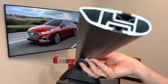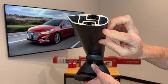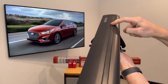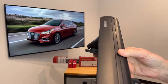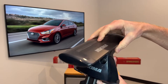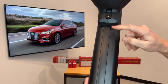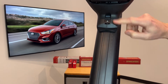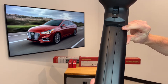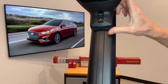This one we've cut down so you can see the extruded aluminum box beam construction. The overall shape is designed to minimize wind noise and wind drag. There is a track that runs along the top of the bar to accommodate certain accessories and carriers for a very clean integrated method of attachment. On the underside of the bar is another track in which the tower is attached. Alongside that track are measurement numbers which correspond to numbers outlined in the instruction sheet for the vehicle to guide you in the correct placement of the tower on the bar.